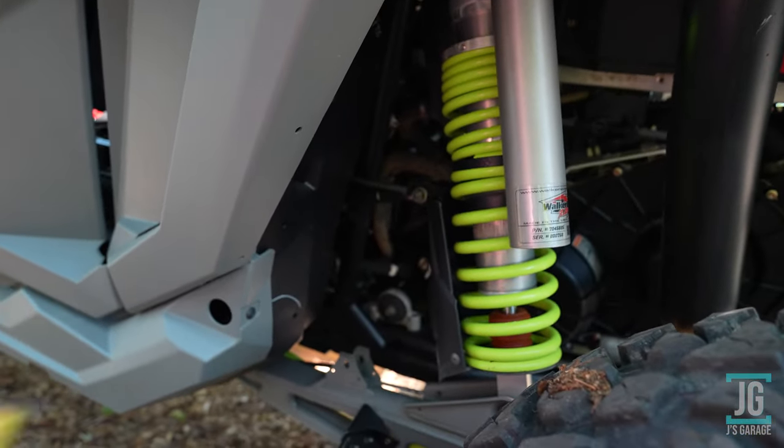But this one looks more like an inch. Yeah, the rear is probably about an inch and a quarter away from being fully bumped. So an inch and a quarter in the rear, and about 2 1/4 inches in the front away from the bump stop. So we're not even fully into the bumps yet. We're that far from touching the bumps, let alone compressing them at all either.